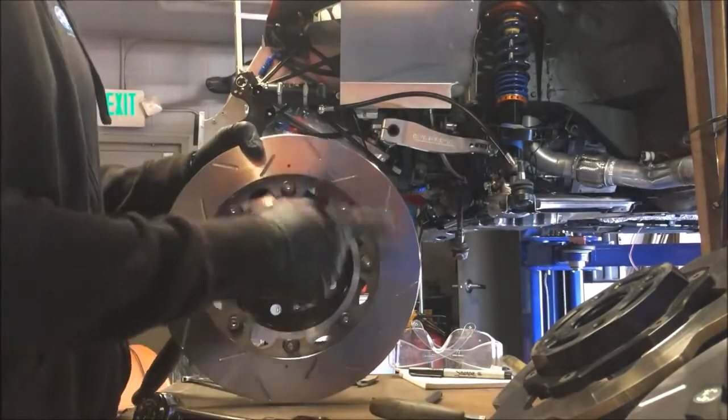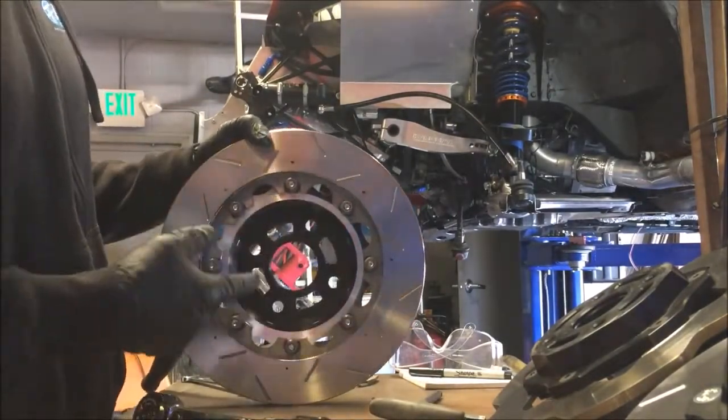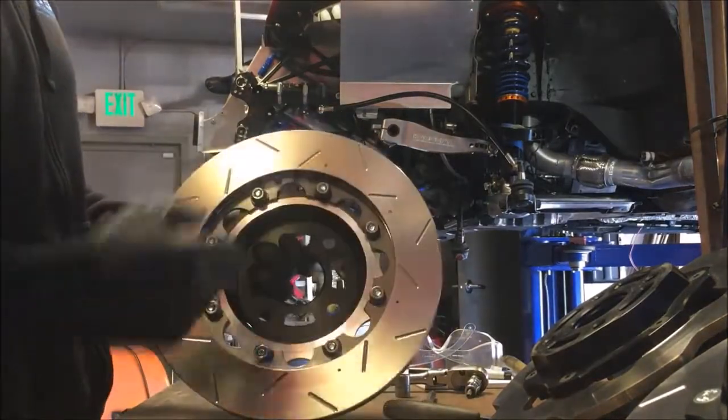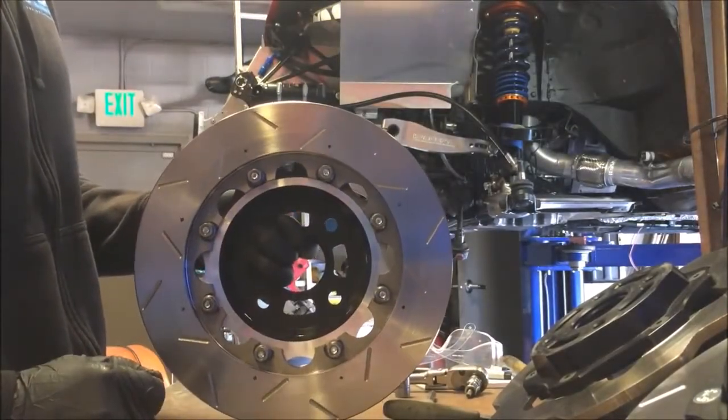And that's it — there are eight dots. Now I know exactly which ones I've torqued and I'm not trying to keep track of it. We've got all of the nuts torqued to 18 foot-pounds. That's the first stage. Second stage is 25 foot-pounds for the V8 Roadsters hardware.